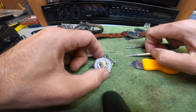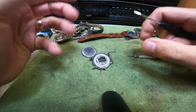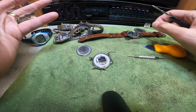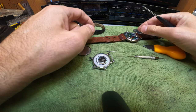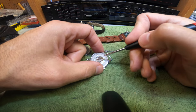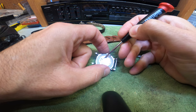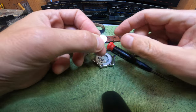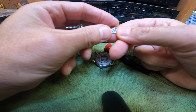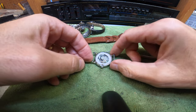So we have a battery here. Usually these Indiglo watches are three volts, so you really can't use a 1.5-volt battery — they have to be a three-volt battery. That's why I couldn't repair this one yet, because I had to order a three-volt battery. Let's take a look — it's a CR1216. Let me check and see if I have it in stock.